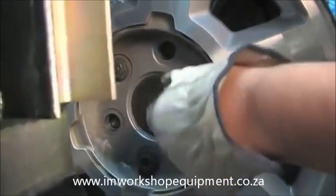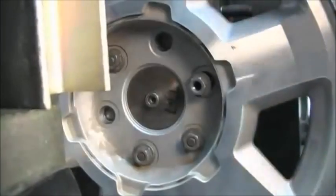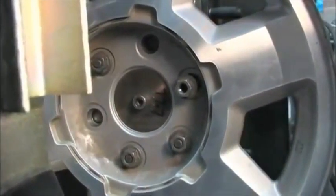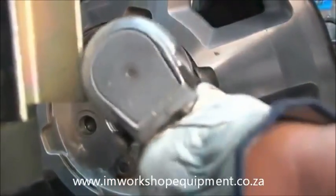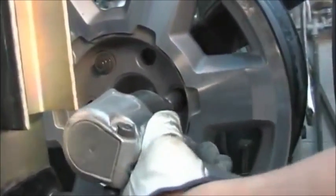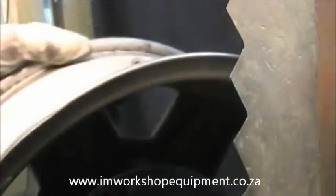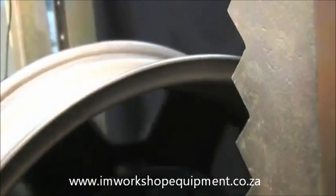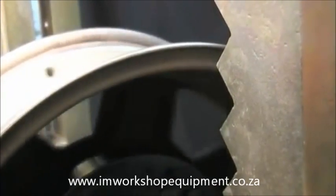You will notice that the mounted wheel now lines up with the floating lug nut pattern. Using your impact wrench, tighten all lug nuts, just as if you were mounting the rim right onto your vehicle. But remember, do not over-tighten. To ensure that there are no obstructions in your rim, rotate it manually. At this point, you can manually rotate it left, right. Be sure you make a complete revolution and check for all proper clearance.